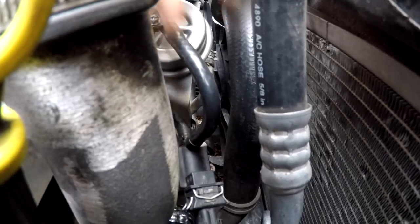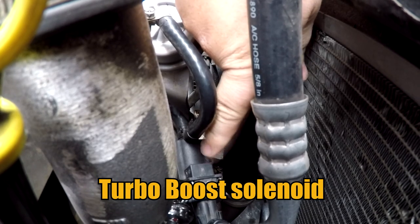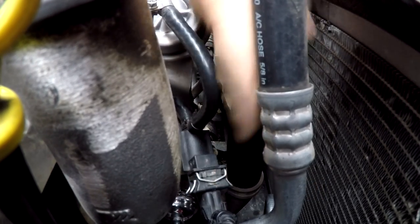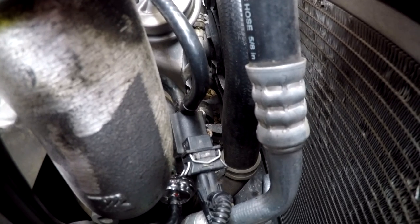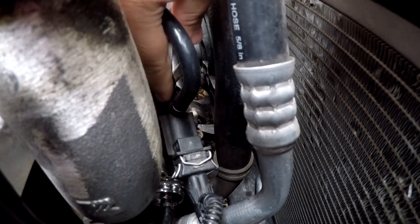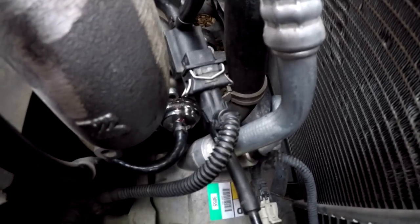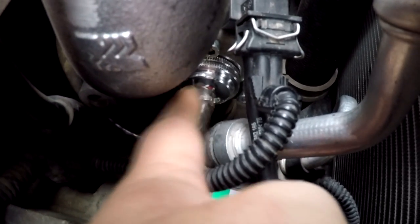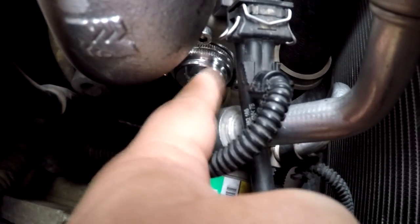That's probably as near as I can get you. What we've got here is our actuator valve up here, this is our electrical connector with three vacuum pipe connectors, and underneath it, right down in the depths, is our actual recirculation valve — the new silver one you can see. The hose connections which Josh correctly identified: this one going to the actuator goes to the top, which is correct; this one at the back goes round and picks up to the other side of the turbo, which is correct. Underneath the electrical connector there was another spout, and we've got the hose which comes around from the back of the turbo — that should go on underneath the third connection down there.